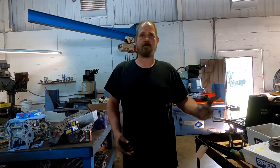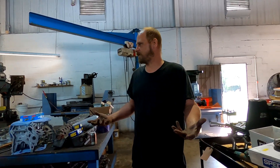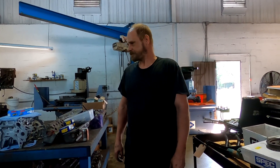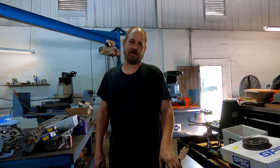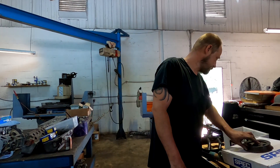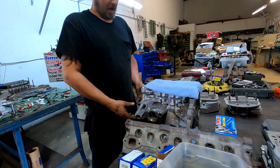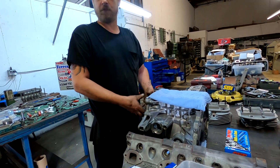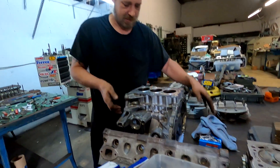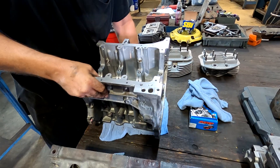Then I'm going to put it in the small boring machine and get it ready to bore, and then Shane can hone it after. That's basically all I can do until I get the crank back from being cut. There are two or three journals on it that were about two thousandths under spec, and that's not something you can make up with the bearings — you want to keep your housing diameter the proper size, the proper crush fit on the bearing. It's all got to be within a couple tenths of a thousandth on the specs.